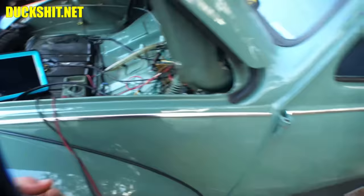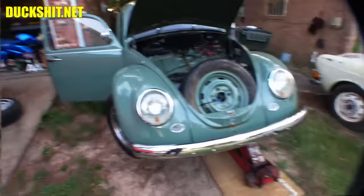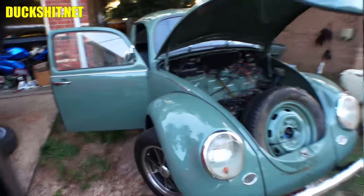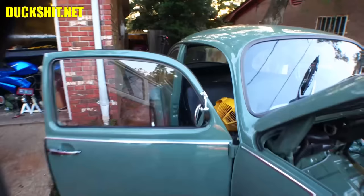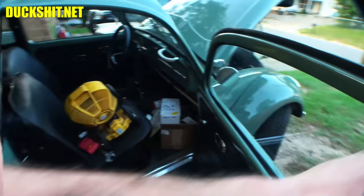We need two brake light switches — we'll get those for tomorrow. I've also got to return that stupid new voltage regulator that doesn't work right. That piece of shit right there — brand new and it doesn't work right. It's not tickling the generator apparently. Because the generator has that extra coil on the DF terminal — you have to power the generator in order to get more power back out of it. The regulator's not sending the power back to that for whatever reason, so the generator doesn't make voltage like it's supposed to. The solid-state one, however, did put that voltage back into it. When I shoved the solid-state unit back in there, it worked. So I'm just unhappy with that unit — it's going back.